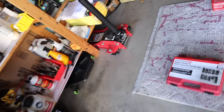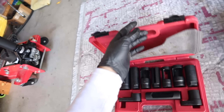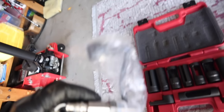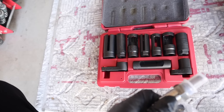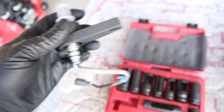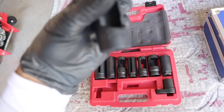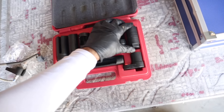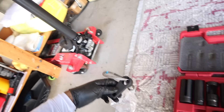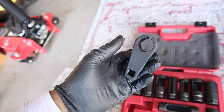Back to the O2 sensors. We're using this highly recommended Harbor Freight O2 sensor socket set — has everything you need for pretty much every O2 sensor. We need to find our fit, and as I guessed, it's 22 millimeter. Car O2 sensors are typically always 22s. You've got the angled socket, a longer deep socket, and a super-long option. For me and Blake, we're probably going to use the angled one because it's in a weird spot and needs some angle.